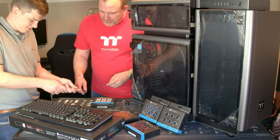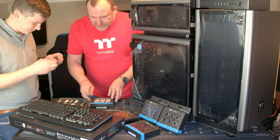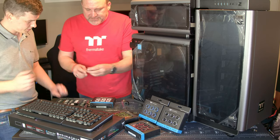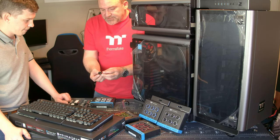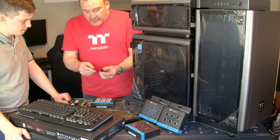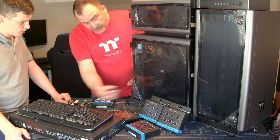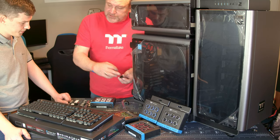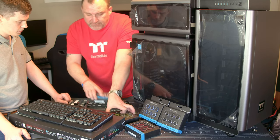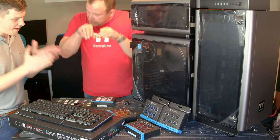Oh, okay, that's a bit different. I've got three pieces. That's right. And an O-ring. So each C Pro fitting has a base plate. That base plate gets attached to your radiators, block, VGA block, pump. So you can have your base plate on either part. You can then measure from 0.0 to 0.0 so you get your measurements right. If you've got two graphics cards in SLI together, you're not forcing the cards so far apart. You can get them very close together.